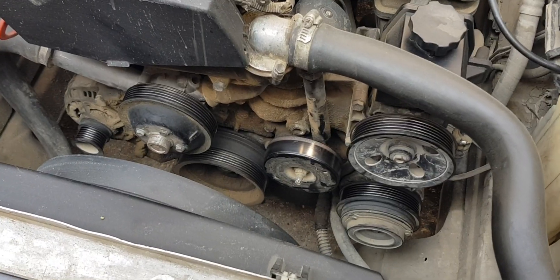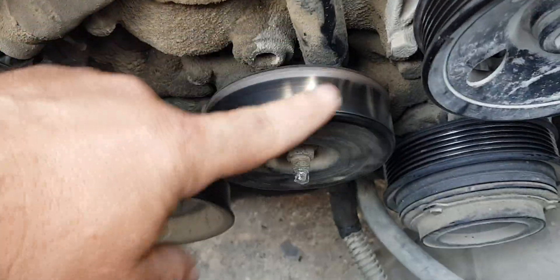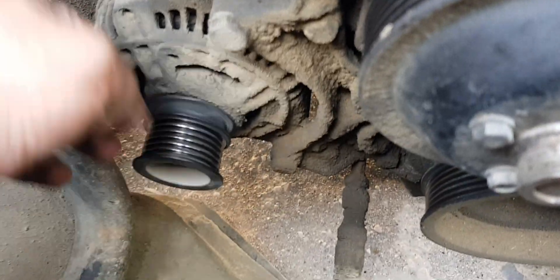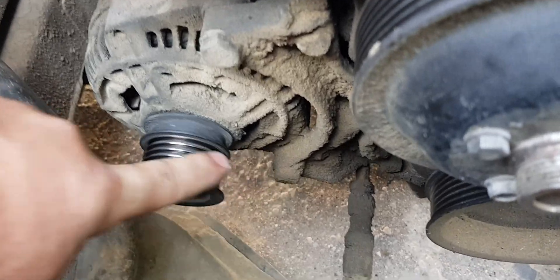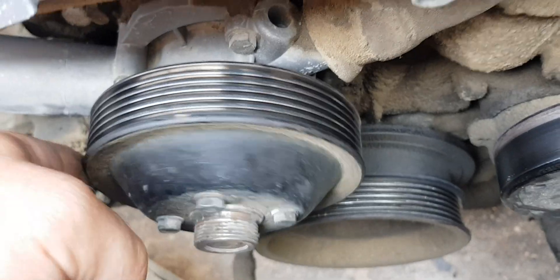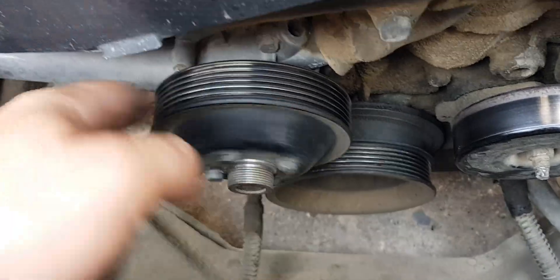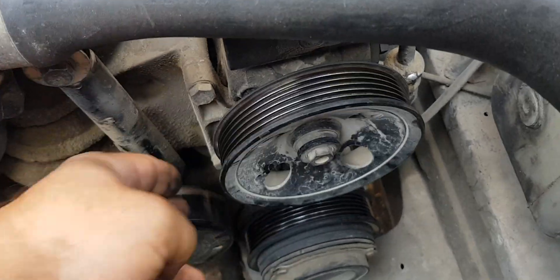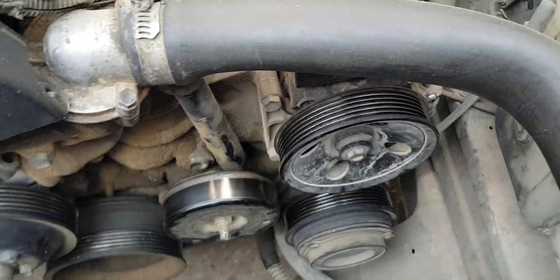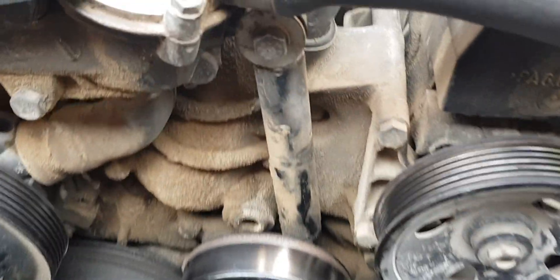Check the condition of the rollers — whether there is any jamming, external noise, or whether the bearing is worn — and whether the roller itself needs to be changed. If there is a hum, the bearing is most likely the culprit. Drive vibration can occur due to a damaged pulley or a faulty tensioner. Before changing the alternator belt, check all other drive elements and address any faults; otherwise a new belt may fail much earlier.